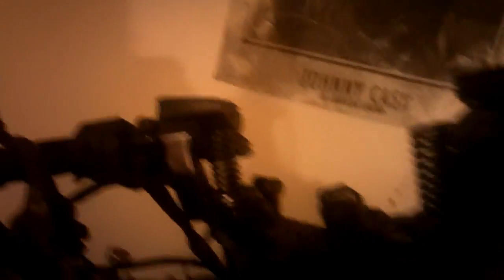Now, of course, when I took the fork caps off, these springs sort of popped out and the whole bike just sort of sunk down. So in order to get them to recess back in, all you do is just simply jack up the bike. Just like that, you get them to recess in, and then you can put the caps back on.